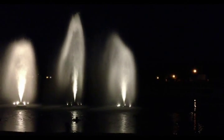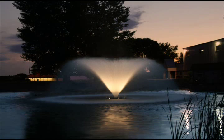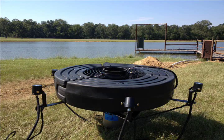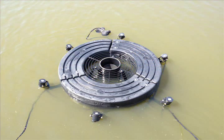These systems are much more efficient than traditional halogen packages. A 3-light kit, the LED 3125, will consume only 27 watts for all 3 lights. In comparison, a halogen 3-light kit will consume 225 watts. The 6-light kit, the LED 6125, is still only consuming 54 watts.